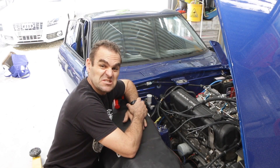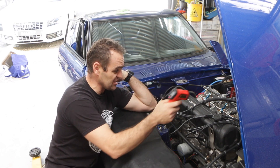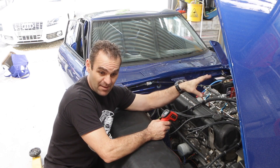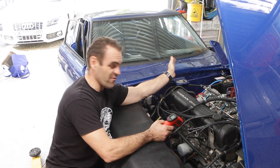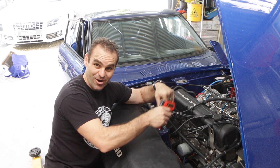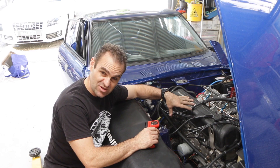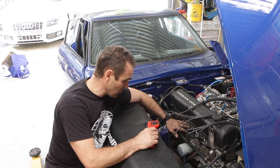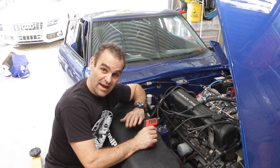We're using a little digital thermometer on each of the exhausts, and they're all over the shop. Some are running really cool, meaning they're running really rich, and others are running really hot, meaning they're really lean. It's not isolated to one carb — it's all over the place, a mix of each. So we're going to go through and try to color tune the car again. We've connected the color tune up to one of the cylinders we felt was running a bit better than the others, and we'll use that as a base point to work forward and backward from.